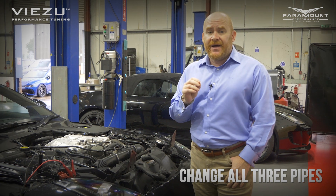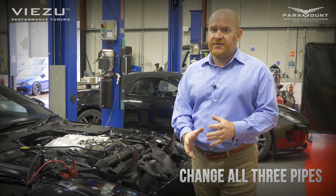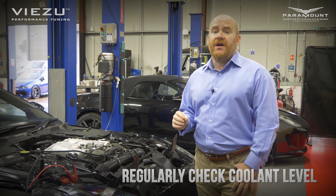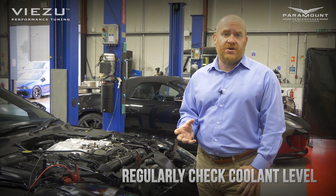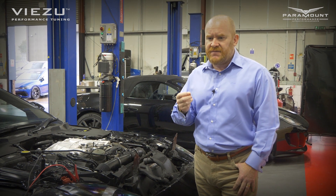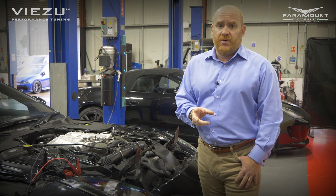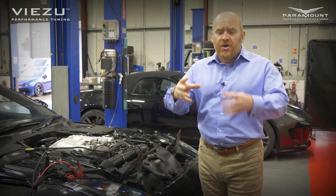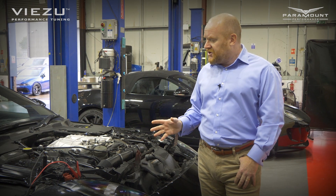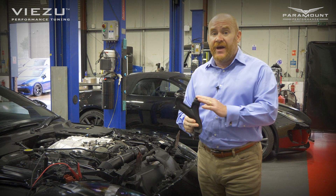Do have a good look at the water pump too. They can weep sometimes from the pipe that goes to the back of the water pump, or the water pump itself can start leaking. So if in any doubt at all, change the pump as well whilst you're there. This does affect both the three litre and the five litre — it's well worth keeping an eye on your coolant level and looking out for any leaks. The obvious way is the low coolant warning light coming on, which is a big warning sign. You can also often smell a coolant leak — the coolant smells really quite sweet, almost like burnt syrup. It's quite obviously noticeable. You get the sweet smell under the bonnet. Sometimes coming off the motorway you might see little wisps of steam coming out from under the bonnet or through the vents. All of those things are warning signs that you've probably got a coolant leak. When you've got a leak on these cars, get it investigated quickly.